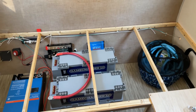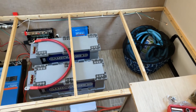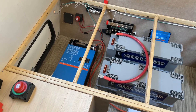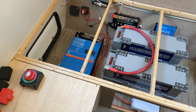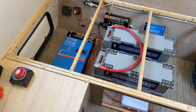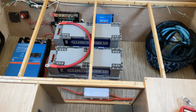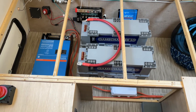We're also going to be adding some temperature sensors to the setup. The Cerbo GX will be taking readings from several sensors. We're going to put one probably in this battery compartment close to the inverter because it does create quite a bit of heat when charging and discharging. The user will be able to monitor that and find out if things are getting too hot - they could open up these access doors to the outside, get some cross ventilation, get some heat out of here.